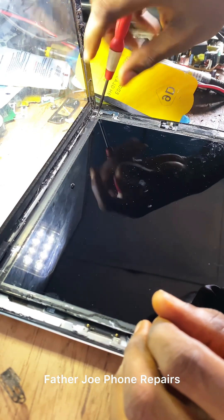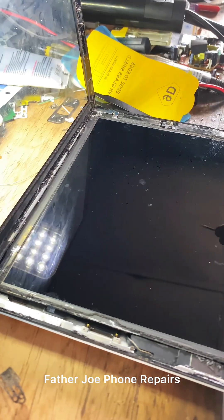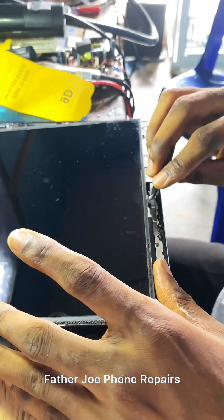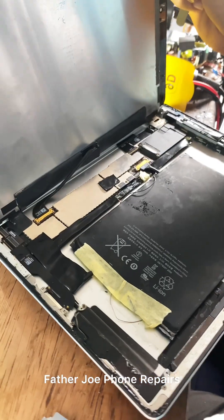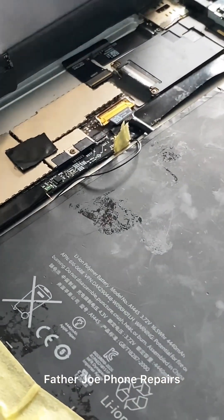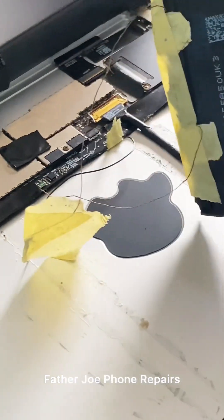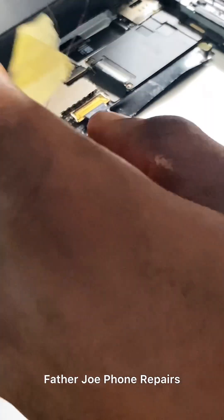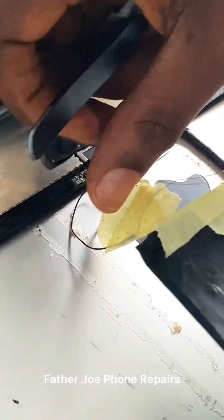Always take time to do your customer's phone. If something happens to this phone, you will be responsible for it. I'm done with all the bolts, so let me remove the screen now. Engineers, right here you can see the problem of the phone — check the connections. The connections are very very bad. Look at the wire they use to connect the battery to the phone panel — it is very bad, not strong. This wire cannot carry enough amps, and this is the problem why the phone is doing on and off.